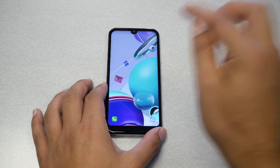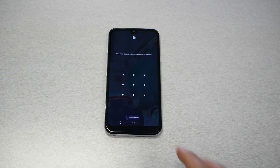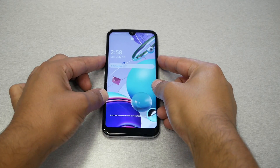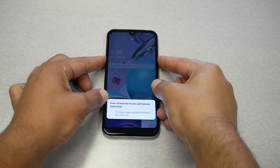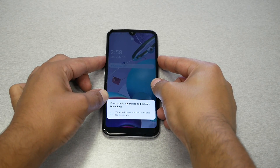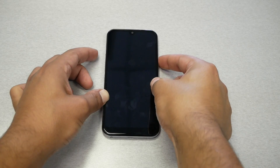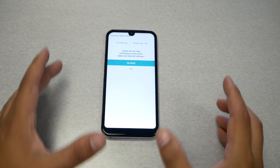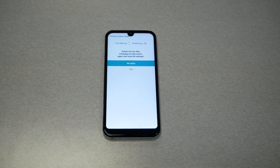Go ahead and press power off — power off again — but the phone won't turn off because you need the pattern or password. If you knew the password, you'd have access to the phone and wouldn't need to do a hard reset. So what you need to do is press volume down and power together for around five seconds and the phone is going to restart. When the phone restarts, immediately remove both fingers, then press power and volume down again — remove your finger from power, keep volume down — and that should take you to the bootloader screen.